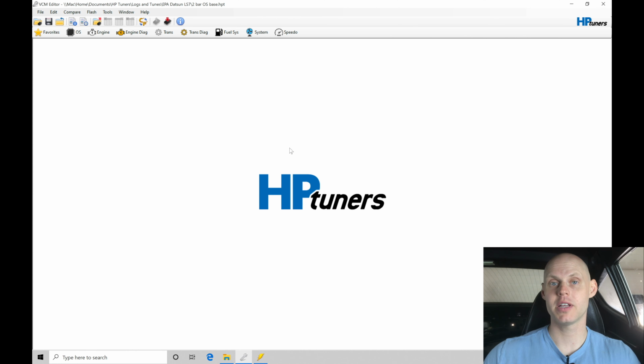Welcome back to our live training session here with our LS7 swapped 280Z. Now in the last video, we created our base calibration file. We updated everything in that initial file that we did the read out of. We converted it to a 2-bar operating system, and we're now ready to get the engine fired up and start our calibration process.